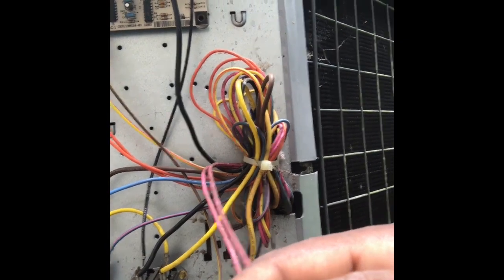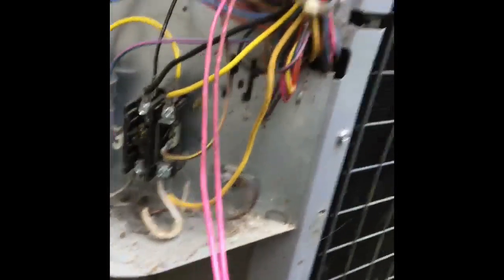Put your leads on one side and the other — positive and negative on your meter. You shouldn't be getting anything when the thermostat is open, because it's an open control. The line is supposed to get down to 30 degrees — some get down to 25 degrees, like this one. But that coil is not getting that cold because it's in AC mode. Only in winter is it supposed to close, so that told me right away the defrost thermostat was bad.